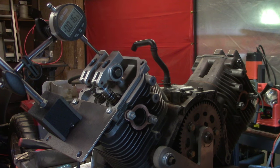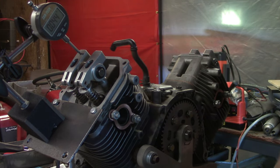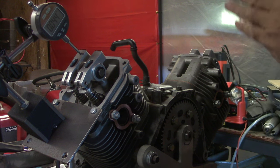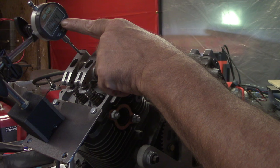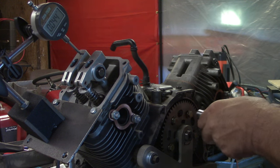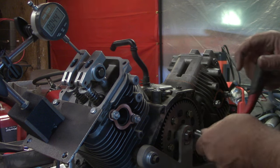We're at the 22 degree mark — looks good. I'm going to rotate the motor over two or three more times and then do a final adjustment to make sure everything is correct. After rotating four times completely around and coming back to 22 degrees before top dead center on the degree wheel, we were at 44 thousandths. So we're going to go ahead and readjust just a hair — that's how I want to do it.